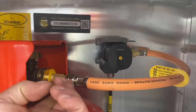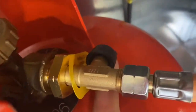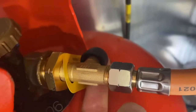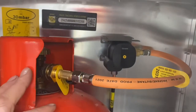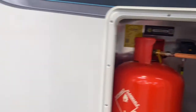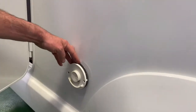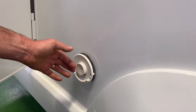To protect the bottle-to-regulator connection, there's this button here where my finger is. When you initially put a bottle on you have to press this button and that will get the gas flowing. You are allowed to travel with the gas on in this motorhome. This is where the exhaust vent is for the central heater — when it's running on gas there's nothing to take off; it's like a balanced-flue heater at home.